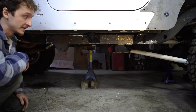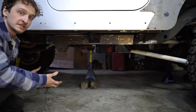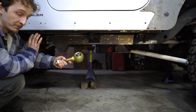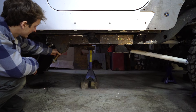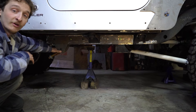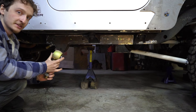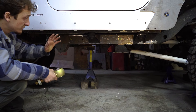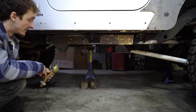What I really liked about these brackets is that the lower control arm mount on both sides is basically part of the entire bracket — there's no single standalone bracket welded to the frame that can break off, which does happen. The Johnny joints we're using are all 1-1/4" — very stout and a step up from heim joints. One issue we ran into is the Johnny joint is a little wider than the TJ frame — it's two and five-eighths thick and the frame is about two and a half. We solved this by cutting eighth-inch spacers, two by two inches, welded on the inside frame bracket, giving us the perfect mounting width.